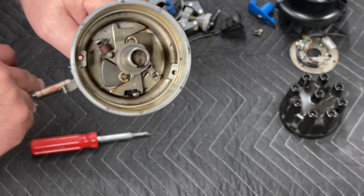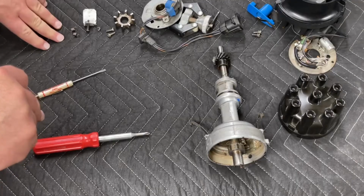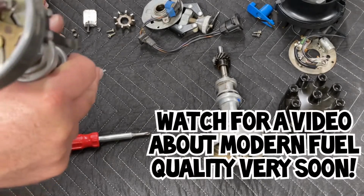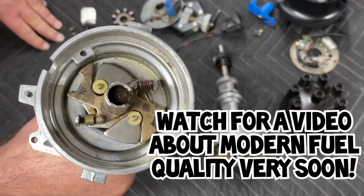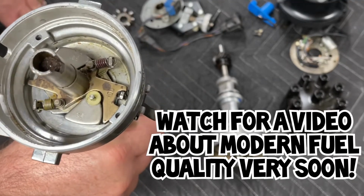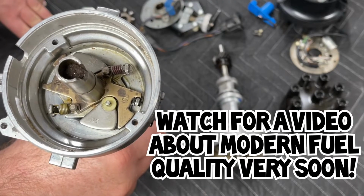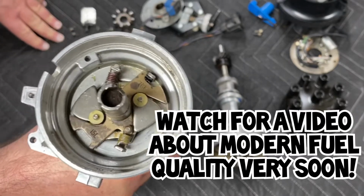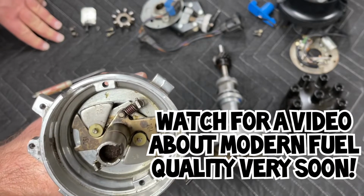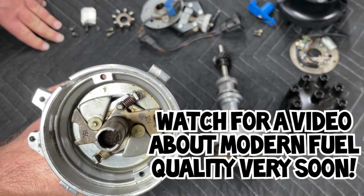There's a lot of arguments about people wanting to still continue to run that much timing. And I'm going to tell you that with modern fuel, you don't need to run that much timing. In fact, you need to run less timing because modern fuel burns a little bit more efficiently and it burns a little bit faster. Now, the key is if you're running the higher octane modern fuel, which is coincidentally pretty close to premium fuel from the 60s because of the change in the octane ratings,